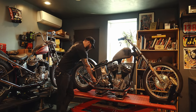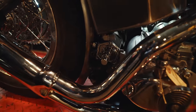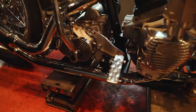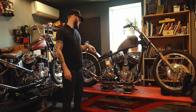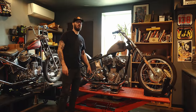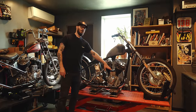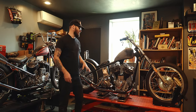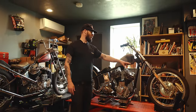This one's going to be kind of weird — it's got an electric start. I've kind of been digging riding Katie's Sportster with this starter, so it'll have a starter on it just as an option — you don't always have to kick it. It'll still have the kicker, but I want it really reliable. It'll have the electric start, but if that doesn't work — if the battery's low — I can kickstart it. I'm running a magneto so this doesn't rely on the battery at all, and I'm running mechanical brakes so I don't have to bleed any brakes.